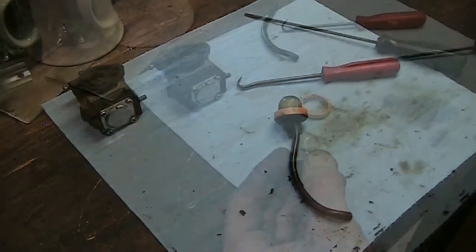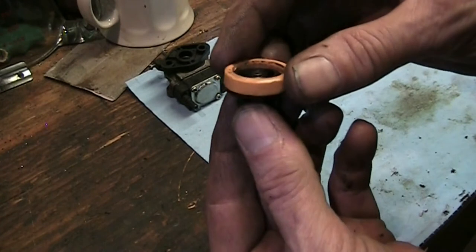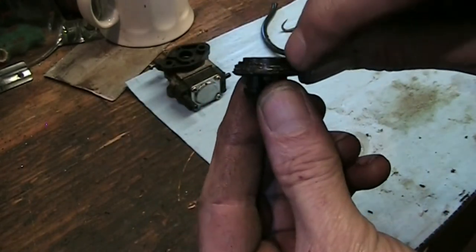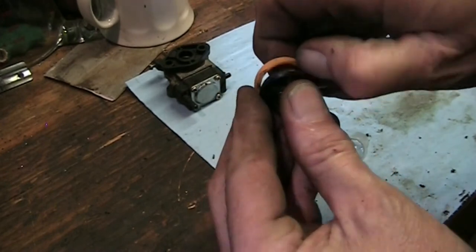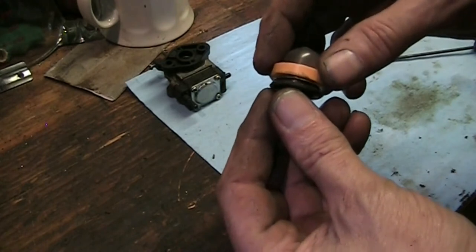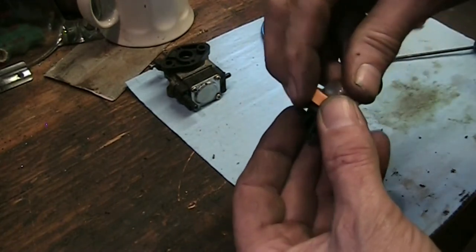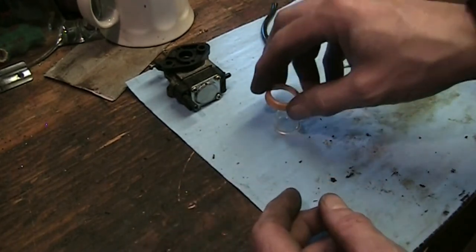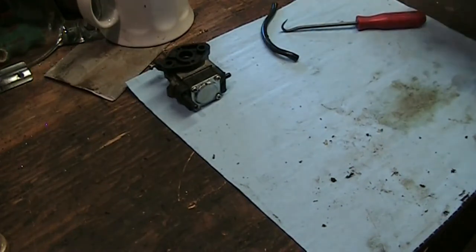So here's where we're at. I used a pair of pliers, ripped off the old crap bulb, and I was able to work a screwdriver around and get the ring off. But there's no ridge in the bottom and no ridge in the base, so basically it was glued on. Even if I put it back together, there's nothing to hold it — it'll just pop off again. Although it does take a standard 11/16ths bulb, I'm just going to order a replacement. They're cheap enough, and the customer is not in a hurry.